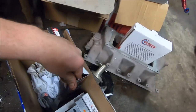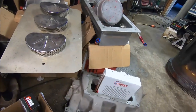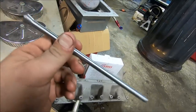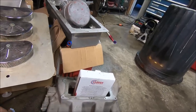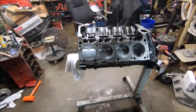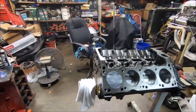I got on RockAuto and they said they carried pushrods for this engine, and I was like there's no way RockAuto carries pushrods for a solid lifter 273. But they do - right off the shelf, ball-and-cup style pushrods. I couldn't believe it. They weren't even that expensive - I think they were about 60 or 70 bucks, versus having a custom set made which would've been about 120 to 130. So we got pushrods for it. We might still get a new oil pan - the windage tray is just sitting on it right now - but we'll see what happens.